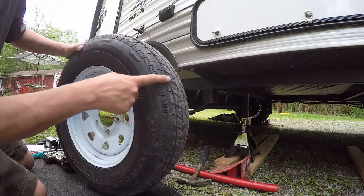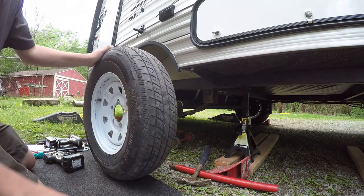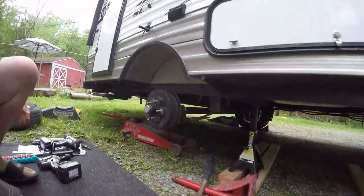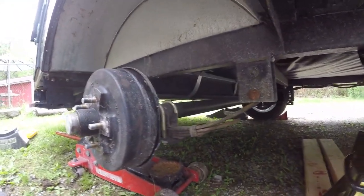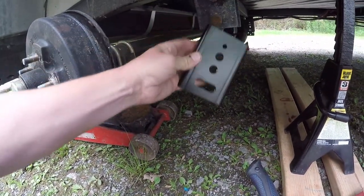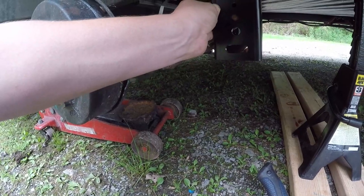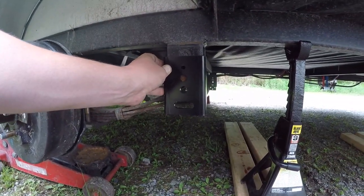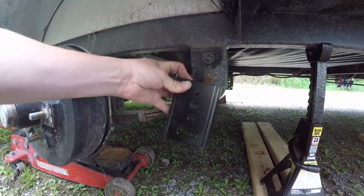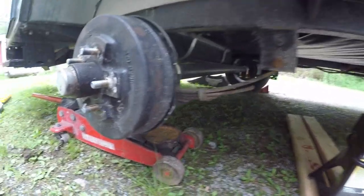You can see how terrible that edge is — it's chopped real bad. The inside edge looks fine, but that to me is the cause of poor alignment, and that's where this kit comes into play. This is the leaf spring perch, and this bracket is going to extend it down. It gives you two holes to determine the height — about an inch or two and five-eighths. I'm going for two and five-eighths. The two brackets install with a little spacer, and this elongated hole is where the leaf spring mounts — that's where the adjustment comes from.